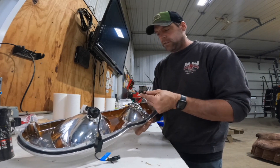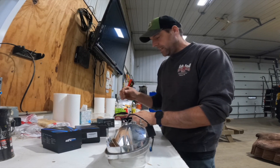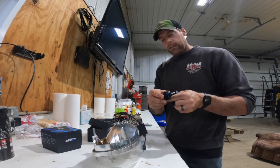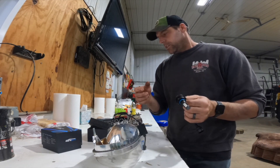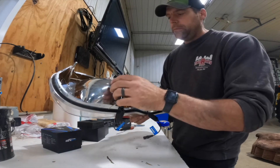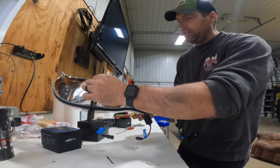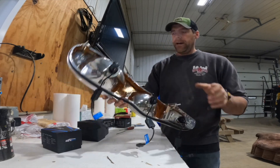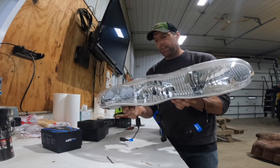It's also important to note that I'm using higher quality zip ties — nothing from Harbor Freight. I tried to get the nicest, heaviest-duty zip ties I could, although you don't need to over-tighten them; they're just holding the spring clips in place. Also important: I'm being very careful not to touch the actual LED with my hands, just like a regular halogen bulb. This set did come with gloves. LED bulbs are installed — checking that they're snug and the O-ring is seated nicely.